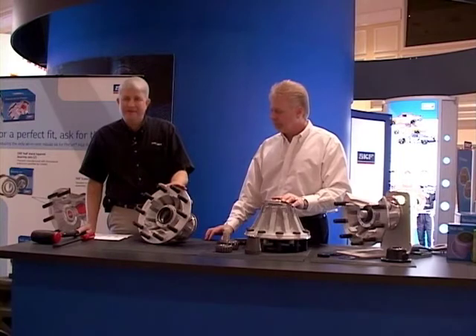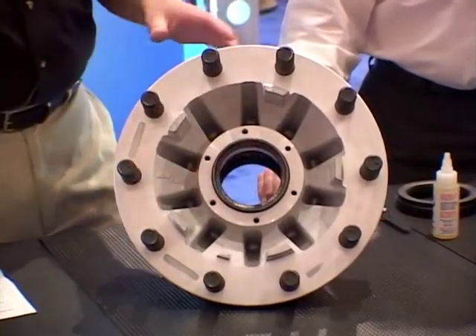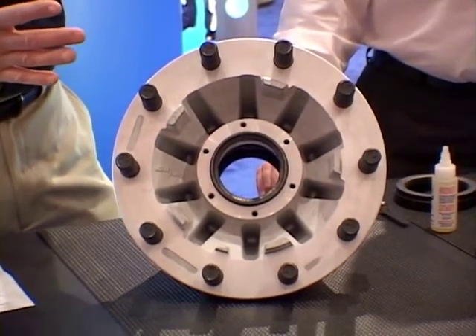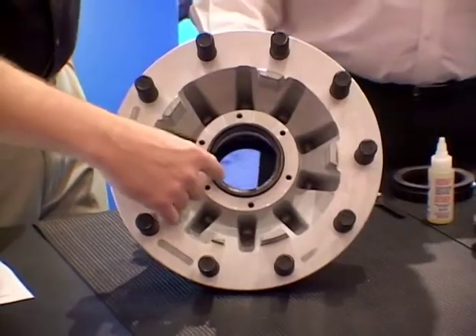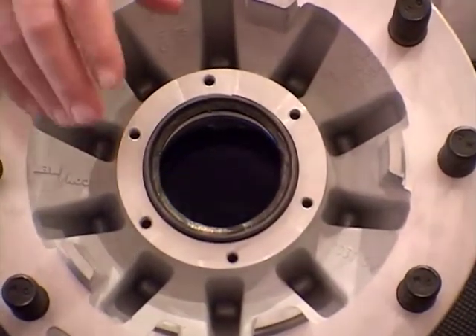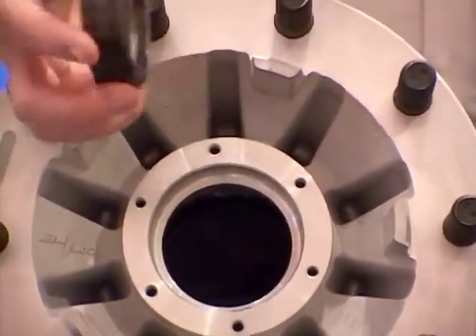In the factory, this hub is heated to 180 to 200 degrees Fahrenheit to install the bearing cups. That's to expand the hub and prevent damage to the bearing race as it's pressed in. It also allows for a greater interference fit when it cools. To remove the race, we like to weld a bead around the face of the race, let that cool — it causes the race to contract, making it much easier to remove the race from the hub without damaging it.